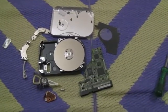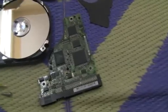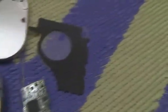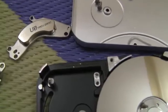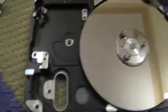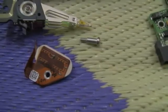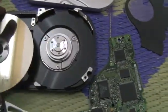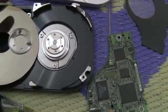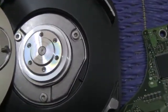Here are all the components of the hard disk which have been removed. Let us see them one by one. This is the board, this is a sandwich between the board and the hard disk, this is the top cover, these are the screws, and that's a magnet which supports the head cover — the magnet shields. This is the head along with the data transfer card, this is the disc, and this is the motor.